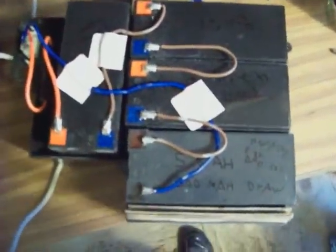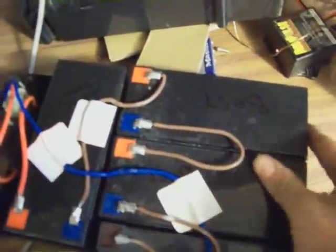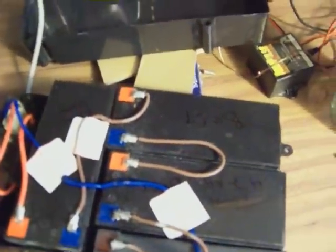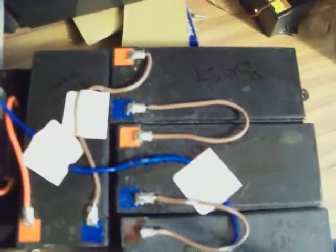Alright, I'm going to shut her down and we'll try the 7. This battery pack has definitely seen better days, but it's definitely above 4.2. I just load tested all of them in series and waited until the voltage dropped off. So I'm just going to pick the best one, which seemed to have the highest voltage at the end of the test under a 4 amp load. Not really 100% sure of the condition of the batteries. Again, it's from my electric bike, it's my spare pack. I got quite a few miles on this, and this battery ran 100% flat in storage. I had a small wiring issue which I corrected, so that kind of screwed up the pack. But we'll try it anyway.